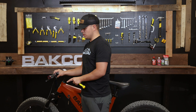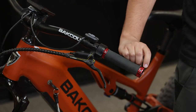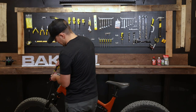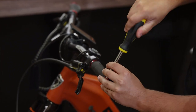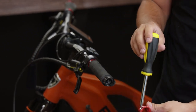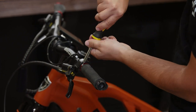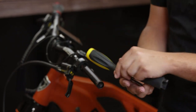The first thing that you're going to do is remove your handle grips. There are two screws located on your handle grip — one on the end of your handle grip and one towards the front of the grip. When you first remove this one, it'll just slide right off. Just make sure you do not lose the screw. Then remove the other one, loosen it up and it will come off just like that.